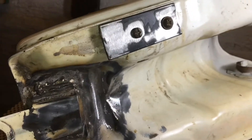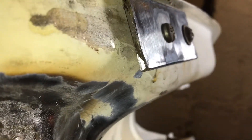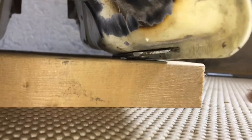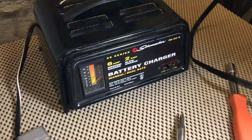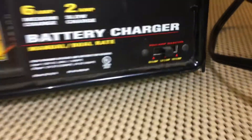I made a block-off plate and attachment point for one electrode at the bottom, drilled a couple of holes, and put that thing in there. It doesn't matter if it leaks a little — it's just going to be on for a few hours. I put it up on blocks to access the underside of the tank and attach one of those electrodes to the extension from the block-off plate. Put in a whole bunch of salt — you need some kind of electrolyte — and a battery charger: 12 volts, 2 amps to start.